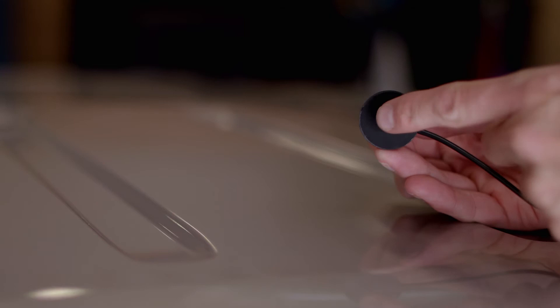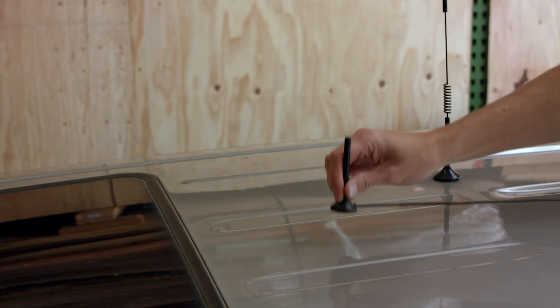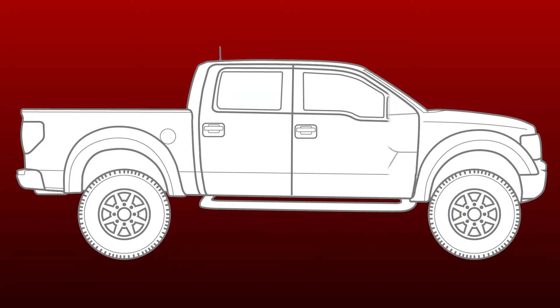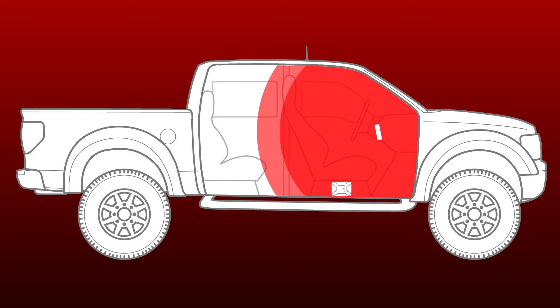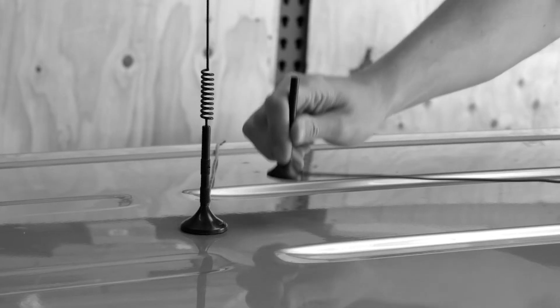Start by mounting the outside antenna. The antenna mounts to your vehicle using a super strong rare earth magnet. Just pop it on the roof and it holds it securely in place. Place the antenna at least six inches away from any windows including sunroofs, and at least a foot away from any other antennas on the vehicle. This is a very important step. Having the antenna too close to a window or sunroof may cause oscillation, resulting in a smaller coverage area inside or possibly shutting down the booster as a safeguard. Placing the antenna too close to another antenna will also negatively affect performance — nearby antennas or metal objects will shield the booster antenna or create interference, resulting in reduced performance.